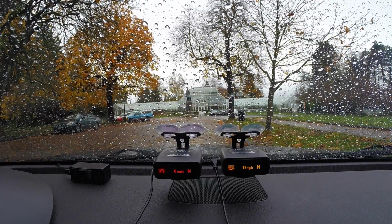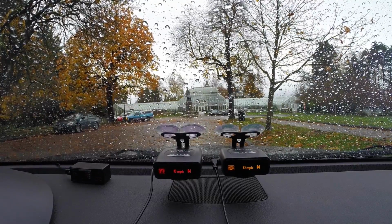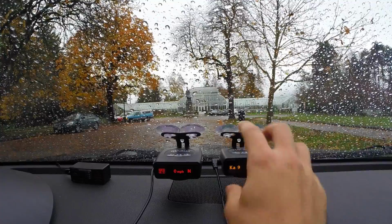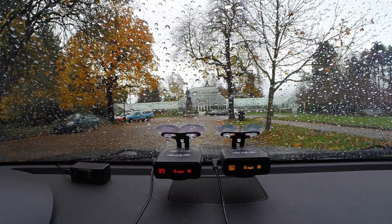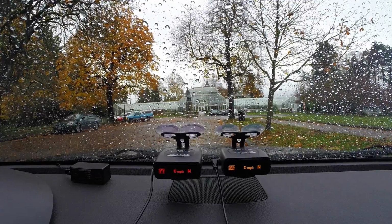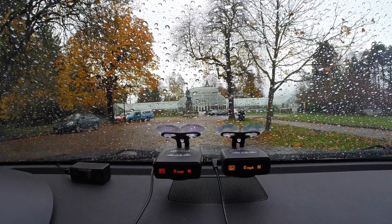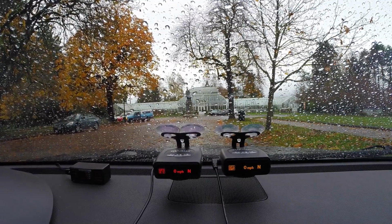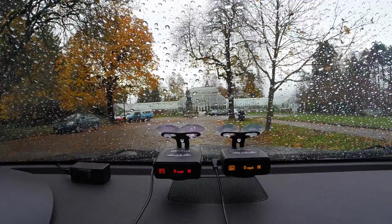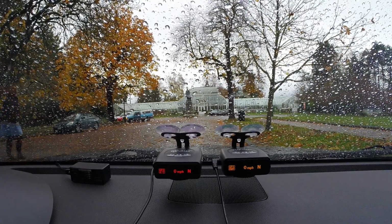And this is something that they really need to get fixed. What they've done in the meantime is they just said, well, I know it's about 34.7-ish, so I'm just going to say it's 34.700. KA band 34.7. Even if it's 34.696 or 583 or 712 or whatever it is, it just says 34.700, so it's not going to give you an accurate frequency display. That firmware update that I was mentioning for the lockouts, for lockouts to work properly, you are going to have to know the correct frequency, and I'm hoping that since they're working on the lockouts, they also take care of the frequency display all in one fell swoop.